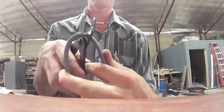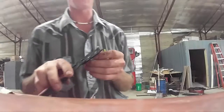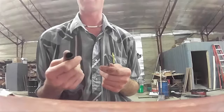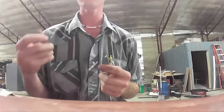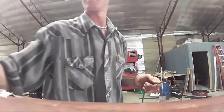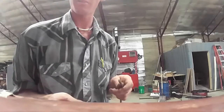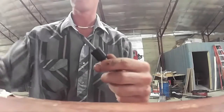Once you have your idea where it ought to be, just take your bare pliers — that's all it takes. Now since these are stripping, you can put your little rubber piece on before you strip it or not, doesn't matter. If you're gonna do it that way, I take a little bit of lubricant and just put it on there so these things actually slide, because rubber on rubber friction — if you don't, you will hate your life. Put a little on there and it just slides on there nice and easy.